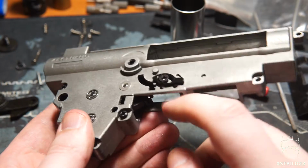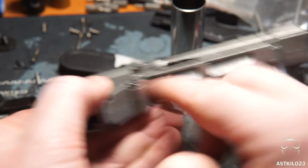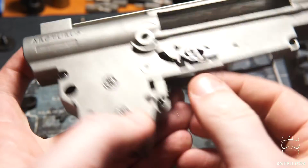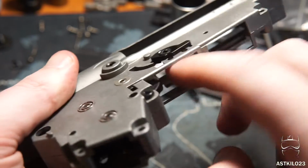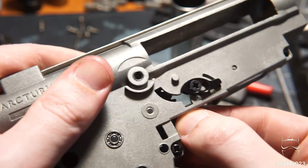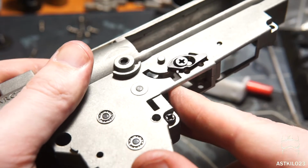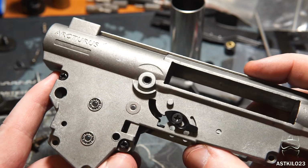All right, first thing, I got the gearbox shimmed here. 13:1 gears are pretty straightforward to shim. Didn't take a whole lot of doing, and I think they sound reasonably good there. Got still a little bit of axial play. They're not OCD shimming perfect, but they're within my acceptable limits for what I consider good shimming.